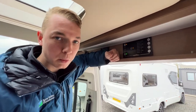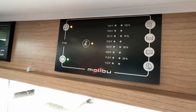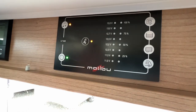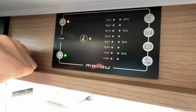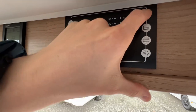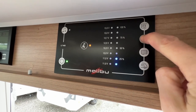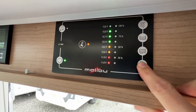To operate your 12 volt control panel, you've got your on/off master switch button at the bottom. That will turn on 12 volt or 240 volt depending on what you have available. If you've got 240 volt, you'll have the mains voltage light on here, so you can plug things into a three-pin plug and get power. If this isn't illuminated, you'd only have 12 volt off your leisure battery. You've got a music icon which turns on the radio off the leisure battery. You've also got leisure battery reading, fresh water reading — you can see 25% fresh water on board — and your vehicle battery reading.